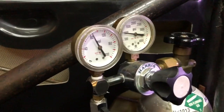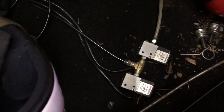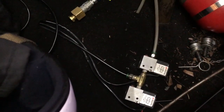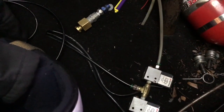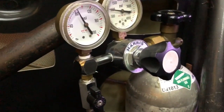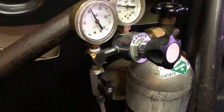With the pressure set, there's about 85 pounds of pressure on the valve. It comes on and pulses from the fill side to the dump side — that's how it maintains the CO2 pressure. The CO2 pressure goes down that line and up to the top of the waste gate. Essentially you're making it appear that you have a varying-rate spring in the waste gate. When you put 40 pounds of dome pressure on it, you've got a really light spring in the waste gate. I run starter solenoid springs off a small block Chevrolet starter — you want as light a spring as possible. Some people don't even run springs; they just let the CO2 do all the work.